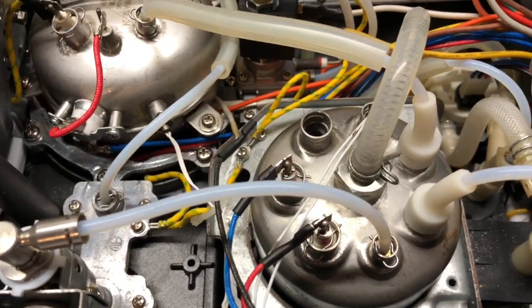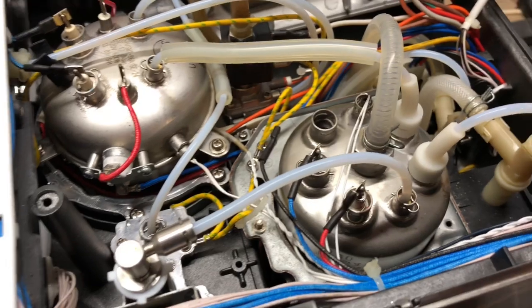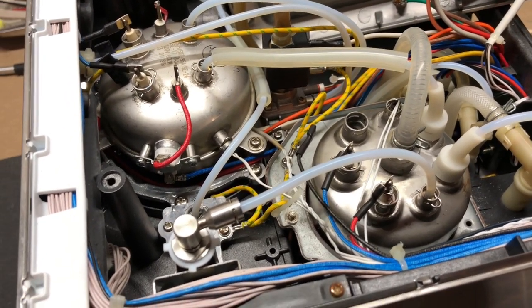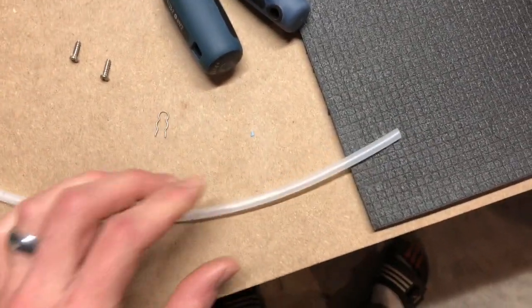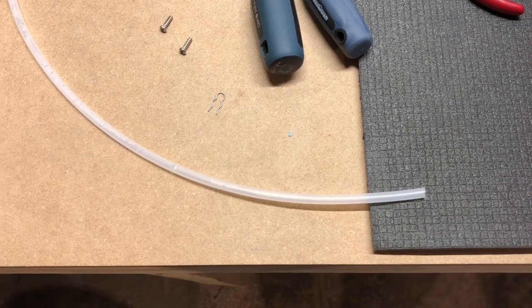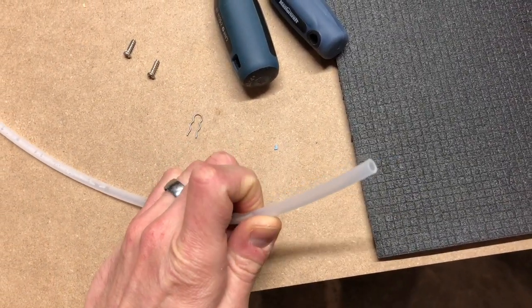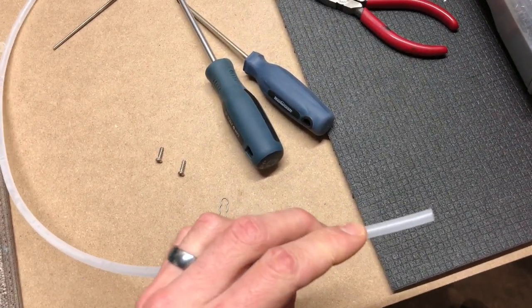This boiler wasn't nearly as bad compared to what I started with, and at this point it's crystal clean on the inside — nice and shiny, which is what I'd expect. There was a lot of white residue that I pulled out of there. Now, how to get in there and drain the boiler: you need two pieces of hose. This is the fairly standard quarter-inch potable water high-pressure supply line available at most hardware stores, used on fridges for the water dispenser and ice maker, or with multi-stage filters.